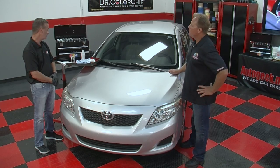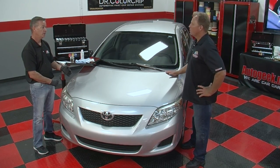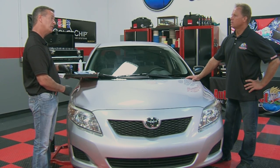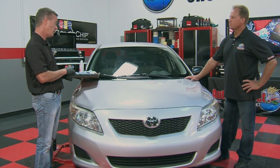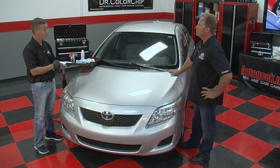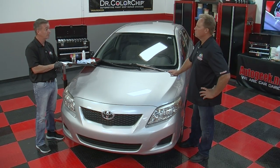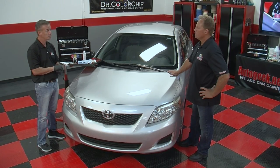Right. One last point. Your brushes are reusable. Just clean them in acetone and make sure, as you're using the paint bottles, that you put a little bit of Vaseline around the mouth of the jar so that the next time you go to use it, it isn't locked down shut. Because if you let paint from the cap get around the mouth of the jar, it could lock down shut. So put a little Vaseline around the rim of the jar and you should be fine the next time you go to use it.